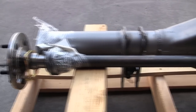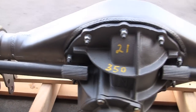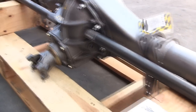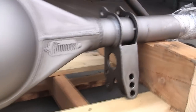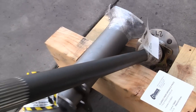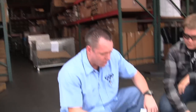This is all the stuff from Curry. Your dad ended up deciding to have it cut down to 56 inches end to end, so they got the measurement right. We got the TCI, sent their axle brackets over, their four link brackets over, and we had everything welded on it for you. So the four link brackets have already been welded on, it's been cut down, it's got the 31 spline axles, the 3.50 gear with the Posi. It's got pretty much everything ready to go.